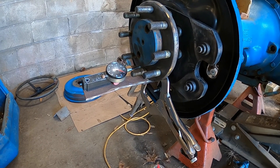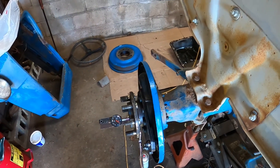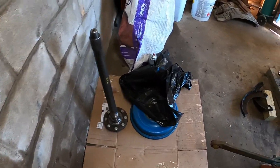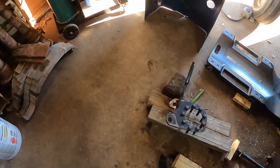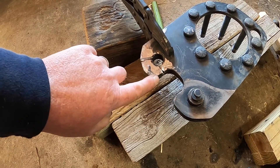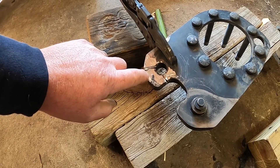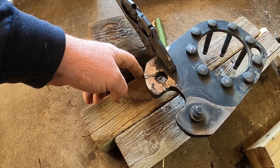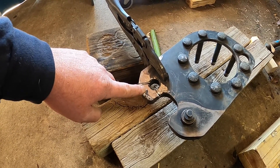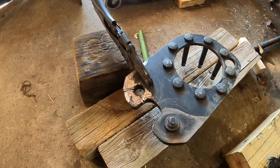We're going to wait and get the other side together and do it just like the book says. Right now it's looking like we need to pull the shim out that I put in there. Which brings up another point I talked about in a previous clip — these are like two pieces here and this had been broke, and somebody had pretty much gorilla-welded it back together. It was loose and broken again, so I cleaned that up, ground it down, beat it out. I'm going to put a couple beads in there, weld around the side, get this situated. After that we'll call it a day and wait till first of the week to come back and put the other axle assembly together and set the end play.